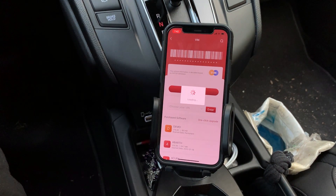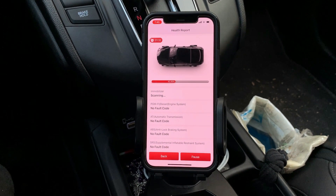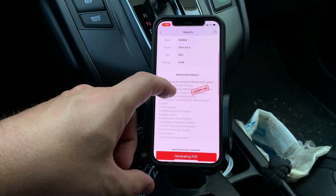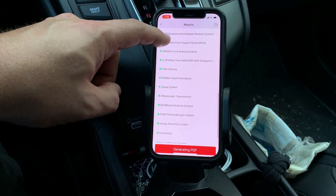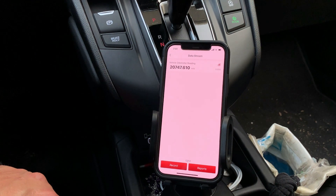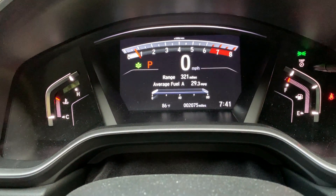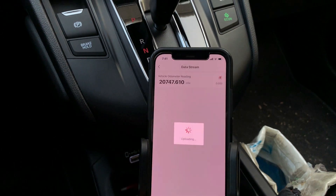This being a newer vehicle with all the different bells and whistles, this 2021 Honda CRV took over three minutes and 30 seconds to finish that health scan. I honestly don't know if this vehicle is even supported by the Think Diag yet, but it's always good to check and make sure everything was initialized and set up from the dealer. In this case, everything looks good to go on this 2021 Honda CRV. One thing I do want to mention is software updates — one year worth of updates on all the vehicles, at least that's what I purchased. That's important because there are issues that are going to pop up. I don't even know if this 2021 is supported right now, but you can see the odometer on the vehicle shows 2,075 miles, while the scan tool is actually coming in and saying 20,747. That's exactly why I test brand new vehicles — hopefully that'll be fixed in a future software update.